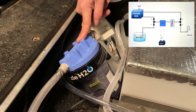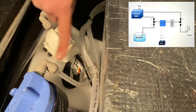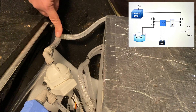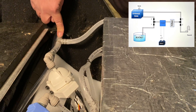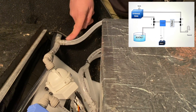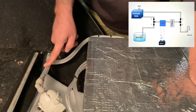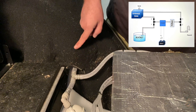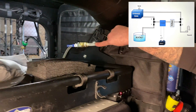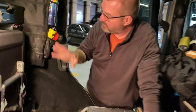When it pumps the water, it goes through the pump on the inlet and brings the water right through the filter. This is the 0.5 micron carbon filter that cleans the water. Then it brings the water through the UV purifier, and then it goes through the second T as in the diagram. It diverts the water in two different directions — either back into the tank, or up through the Jeep and back to my faucet in the back of the Jeep.